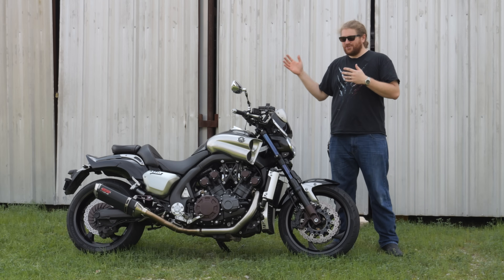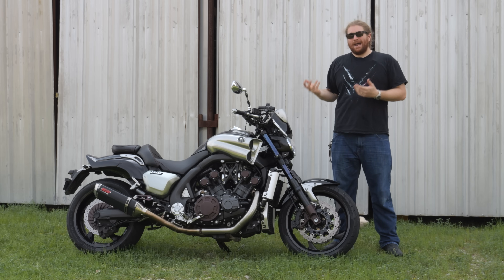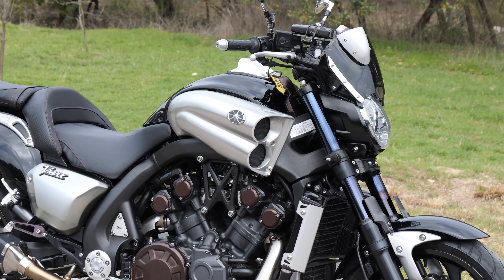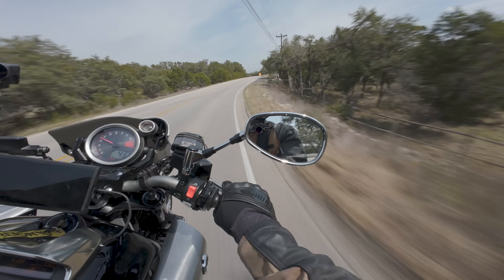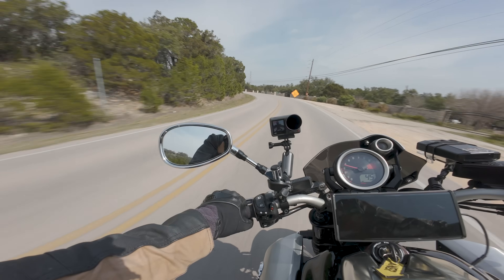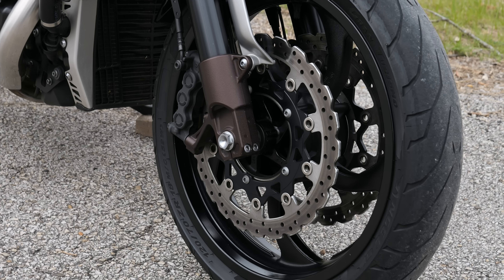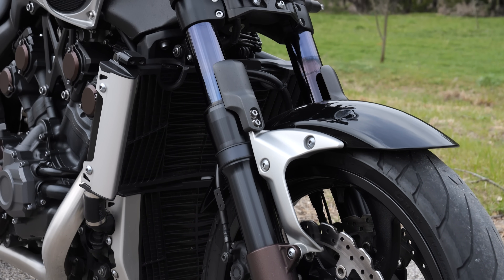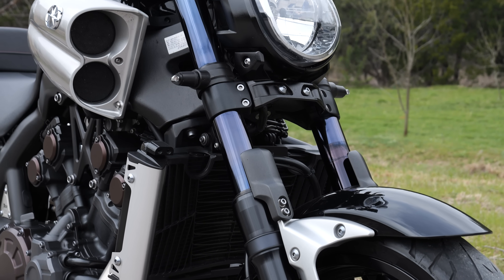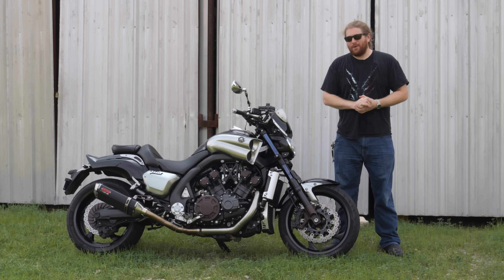We already talked about the gas tank — it is stupidly small. You are putting 93 octane in here all the time, so you're going to be spending a lot of money on this bike. The rake angle on here does push this front tire very far forward, so the handling is slower than you would expect. And we have an 18-inch front and rear on this motorcycle, which means you're not exactly going to be able to put sporting rubber on here. I really wish that cruiser manufacturers, when they're trying to make a sporty cruiser, would just put 17s on your bikes. This could run R1-style rubber — you could put S22s, S23s, whatever you want. But it's 18s. That's stupid.